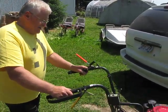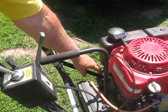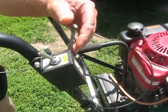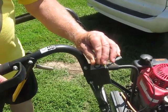We're recording right now. All you do is pull the choke lever out with about half throttle, turn the switch to on, and it'll start.